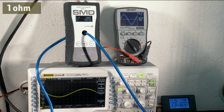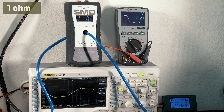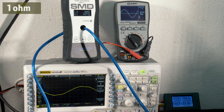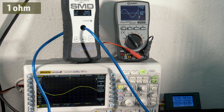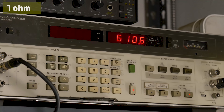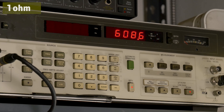Finally, we tested at 1 ohm, 40 Hz, starting at 14.3 volts. At -4 dB, we got 650 watts on our AMM-1 but dropped to about 602 watts when our power supply and batteries dipped to 12.42 volts while consuming nearly 80 amps of current. We also got 610 watts on our HP with 5.4% distortion.